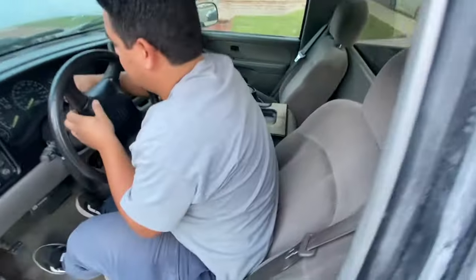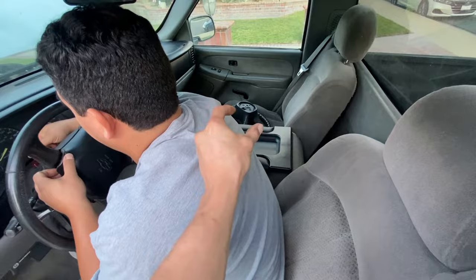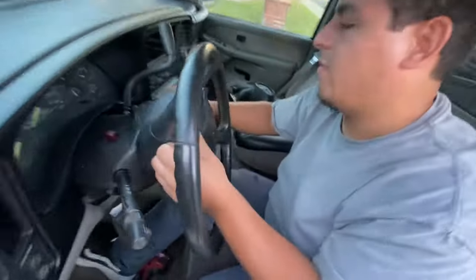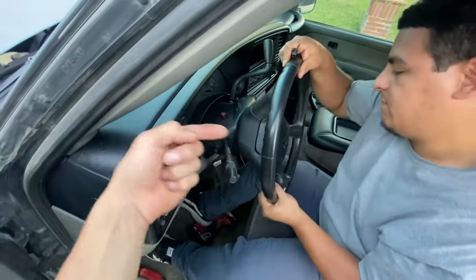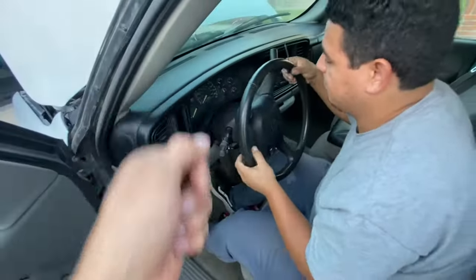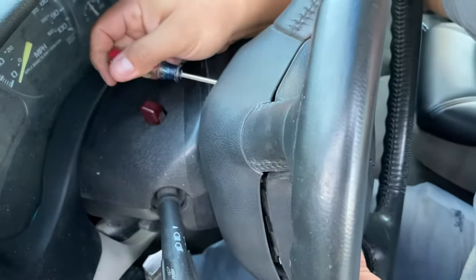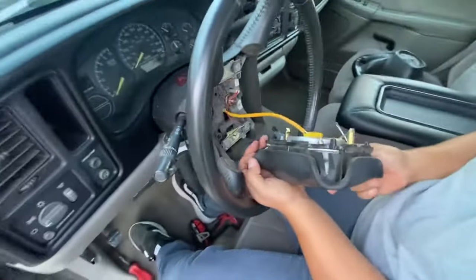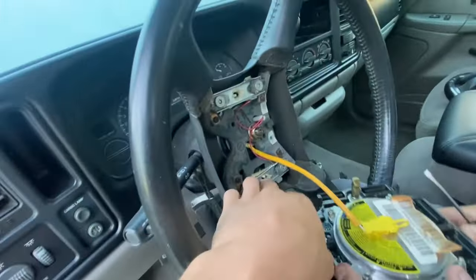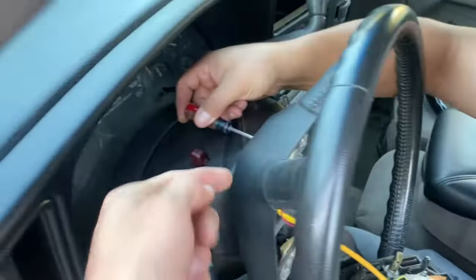This style is a little different than the cat eye steering wheel. That one has just two pins on the side that you just poke and they come off. These are going to be on the back side — you kind of have to go in from behind with a screwdriver and poke it in, and then it should get the airbag off. You can see it's going to be here, here, here, and here from behind.